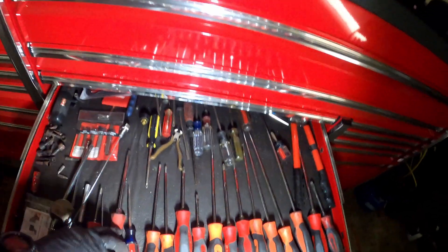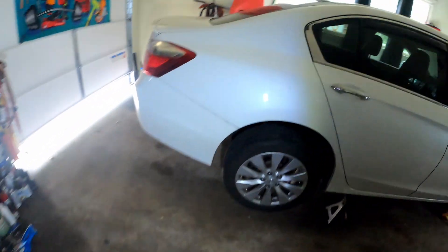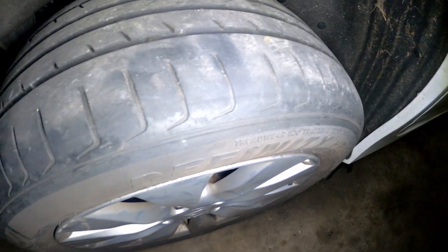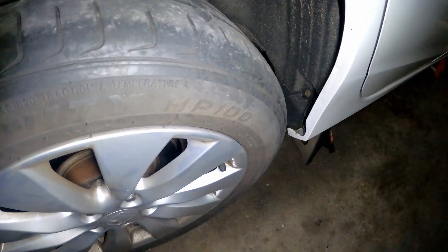The way you can tell when your tire is bad - I usually tell this to all my customers when they come into the shop. See this little bar right here in the tread grooves? When your tire tread gets low enough, it will even out flush with that bar - that's your wear bar. Once the tread is even with the wear bar, you need a tire. Most people don't have a tire gauge, so just come outside and look at your indicator bar and check for deterioration anywhere on the tire, not just on the edge.